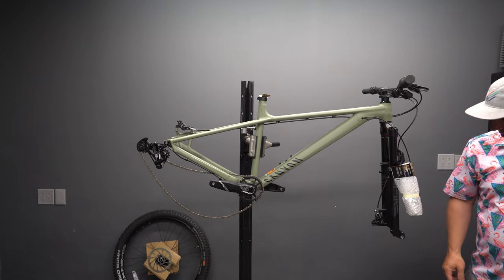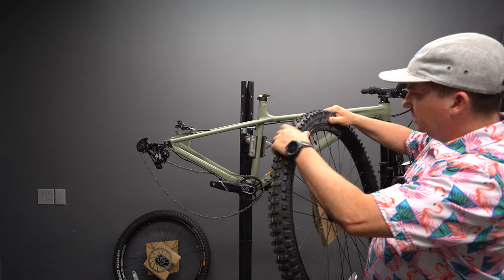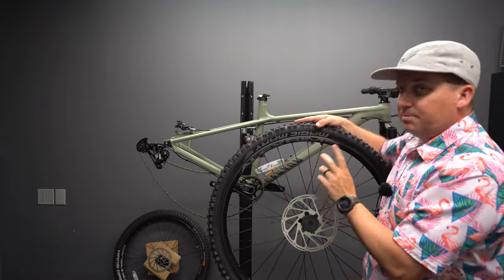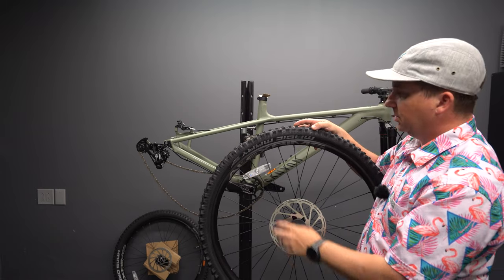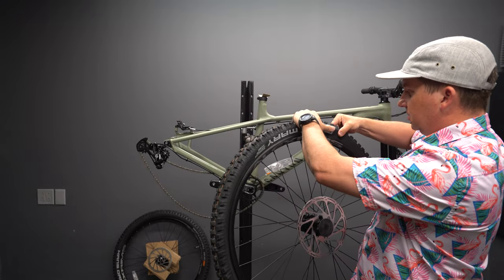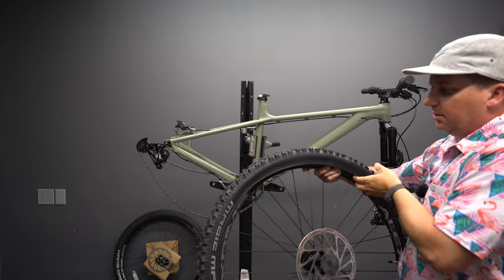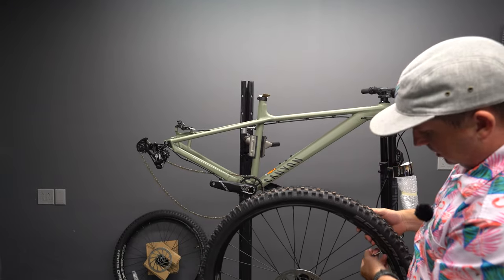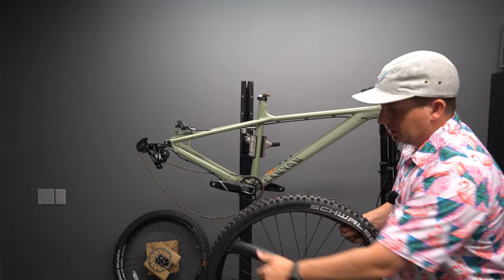Let's see if the front is set up tubeless or if there's a tube in there. Almost always I get these bikes and there's tubes in them — and yeah, there's a tube in here, so I'm going to have to pull it out. Personally, I wish companies would start shipping bikes without tubes installed, with just the valve installed, so all you have to do is squirt some sealant in and inflate it. It saves people a lot of time, and if they want to include the tube, just pop it in the box as a spare. I'm hoping 90% of Canyon Stoic owners are going to run these tubeless.